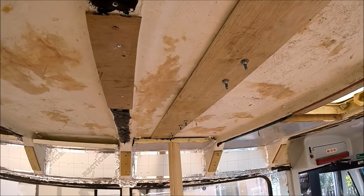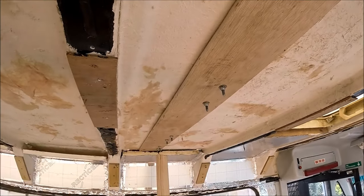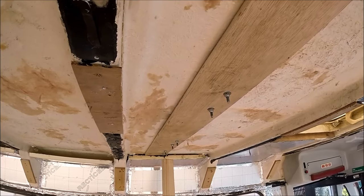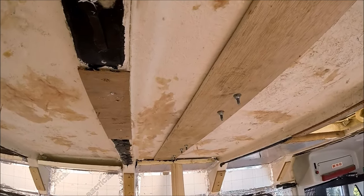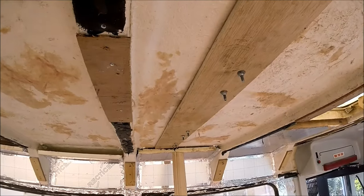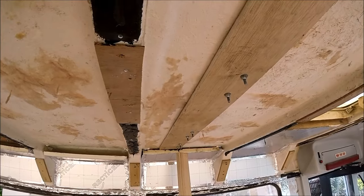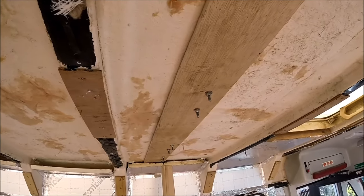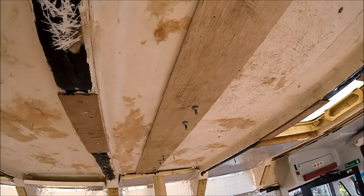So there's already sealant underneath the brackets, sealant going through the hole with the nuts, and sealant around the top of the nuts with the washer. I say just to be 100% sure beyond that, I'm now just going to pop up and put a cap of sealant over the top of the nuts as well. Then, as I said, there should be absolutely zero chance of any water ingress coming through here. And that'll be some fully secured solar panels bolted onto the roof.